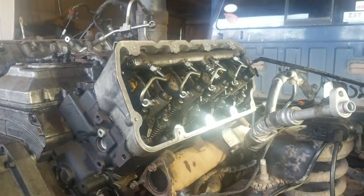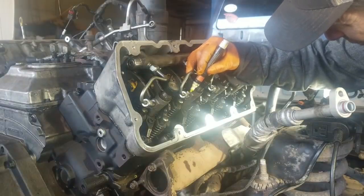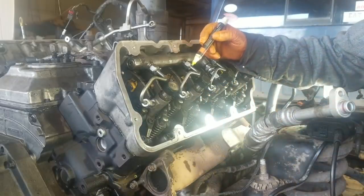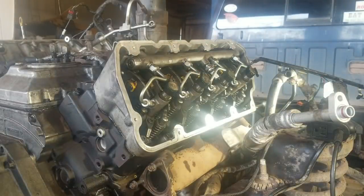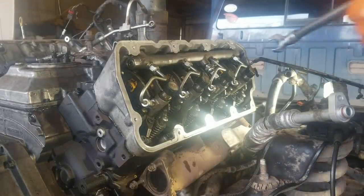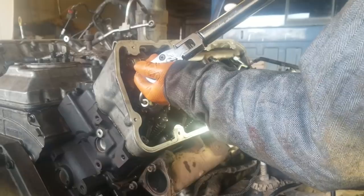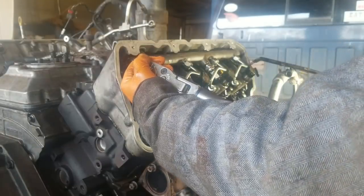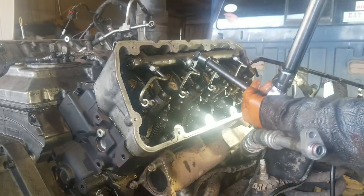Okay. So let's mark right here in the center of this flat, right there. And the center of this flat will be one complete flat moved over. Let's go with torque angle again and see where this winds up. I would say it's pretty well dead on the money. This torque wrench is pretty damn accurate. So I guess I need to quit worrying so much.